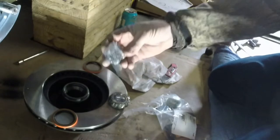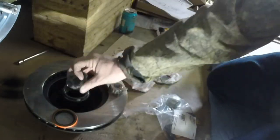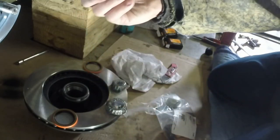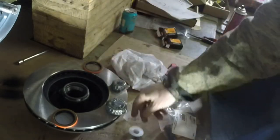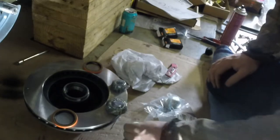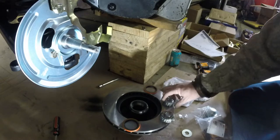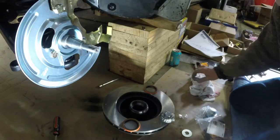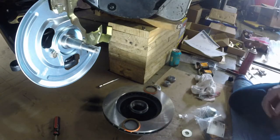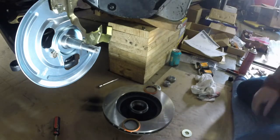All right. So we're gonna have to seat the bearings in this bad boy. Okay. All right, let me grab what we need next. Okay, so got our bearings. Large and small. The large one goes in the back. The small one goes in the front. Castle nut, center cap, washer, and I believe we're going to need a cotter pin. They gave us quite a few, so I'm going to take a few out here. I'm going to rest those up here. Okay, front bearing, rear bearing. Lay all my parts out. I'm going to put the parts back to the other side in the box.